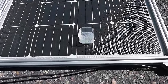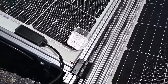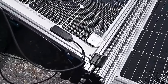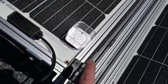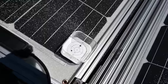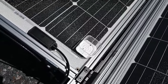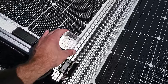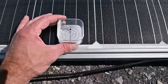All right, so first everyone's going to complain, like, oh, why are you only getting 1200 watts out of a 2000 watt system? Okay, so here's the panel that's tilted, in this case, towards the sun. It's currently almost November, and you can see this little guy. There's a dot and another dot, and the shadow indicates the angle of the sun, and that's right around 15 degrees for this tilted panel. So even the tilted panel is at 15 degrees, and then if we go to all the flat panels, it's not even on the scale.